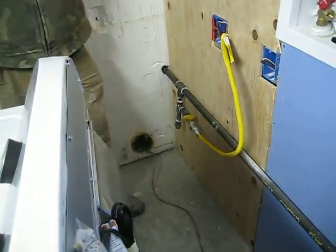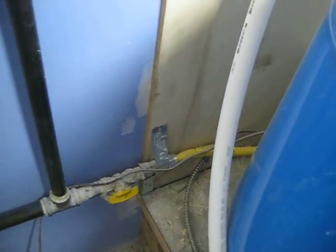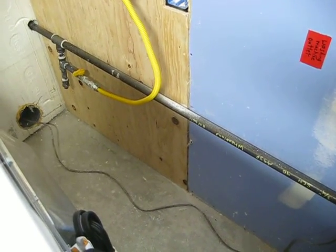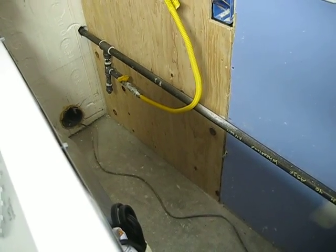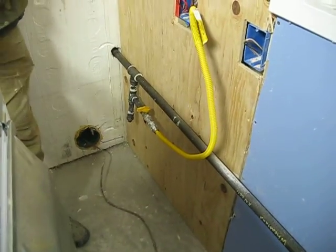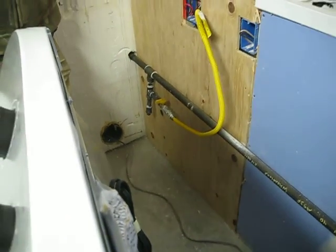So are we gonna be able to get the vent out there and leave that cord? Because what is this cord connected to? It has to do with the outside temperature for the boiler. Yeah, it's connected under there somewhere. So what I'm going to do is when I cut the sheetrock out, I'll just notch it so the cord will fit and just leave it alone. Okay. And then we can put our vent through and connect it there. And call it good. Okay, I guess the utility room, it doesn't have to be pretty.